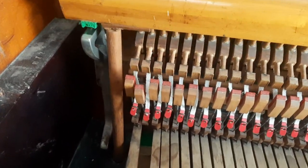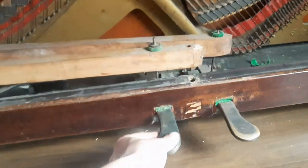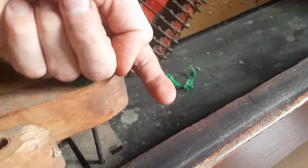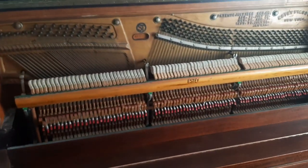So this is the silencing bar, it comes through, and it's quite challenging to show, but in any event, once you open the bottom cover, this had come loose and off. So I just put it in there and tried to match it with the other one, and you can see the pins here, it's really just to get it in between a hole and underneath here. How it's attached, it's just straight down with a little hook bend to prevent it from coming through. And at the tip there, it's not a bolt going all the way through, but just a little point to keep it from bouncing up so that this can still pivot down. And then it pushes a stick. This is in two separate sticks, one at the bottom here and a new one up top there. But a pretty easy fix. Just put it together again.